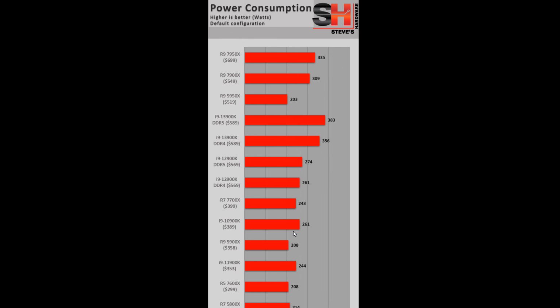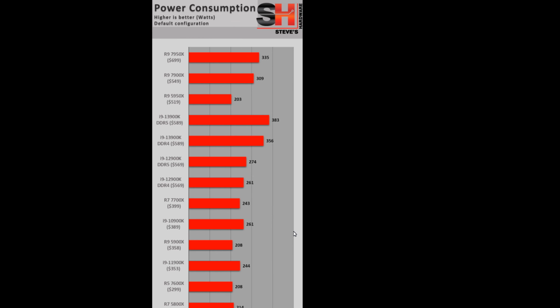But this one is much higher frequency than the 12900K. The 12900K went to what, 5.1, 5.2 on Turbo Boost 3.0? I think 5.1. This thing goes to 5.8 if you can keep it under 70 degrees Celsius, and if not, it'll still go up to 5.7 under normal turbo mode. Thermal velocity pushes it to 5.9. But if you push all cores past like 5.5, you're going to throttle. It's going to happen. You're going to have a bad day. So basically, you want to tune in an overclock that's a little bit different, and let's talk about that now.